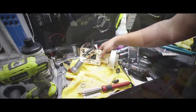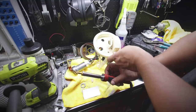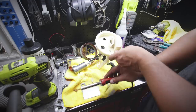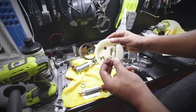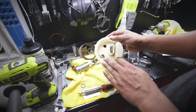All the holes are drilled, and this one I drilled out needs to be filled in using a plastic welder. A plastic welder looks like a soldering iron because that's basically what it is — I picked this up from Harbor Freight. It presses down with heat on whatever plastic you want to weld together. Since we have a little gap here, I'm going to do a skin graft using the piece I cut off earlier, since it's exactly the same type of plastic. I'll cut a little piece, put it over the gap, weld it all together, and it'll melt into one strong piece.